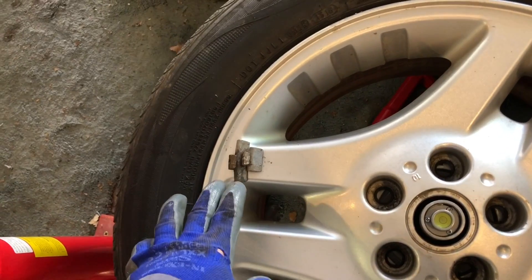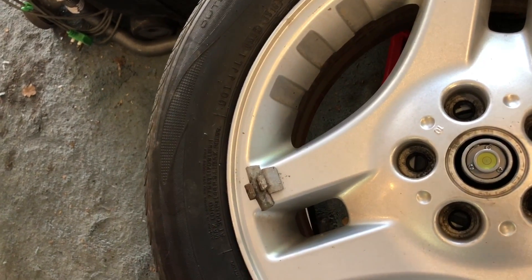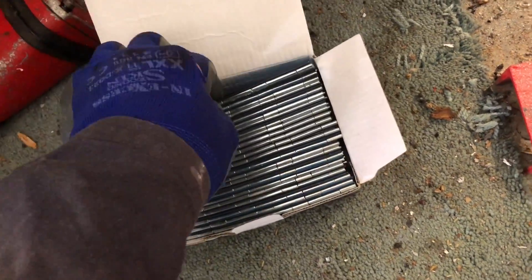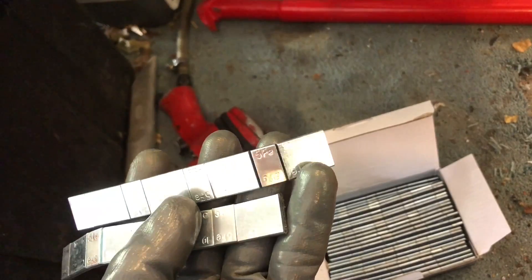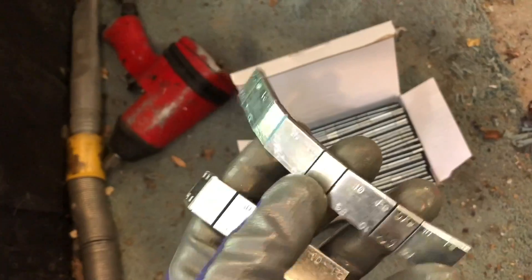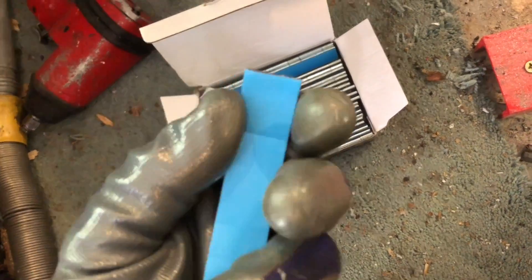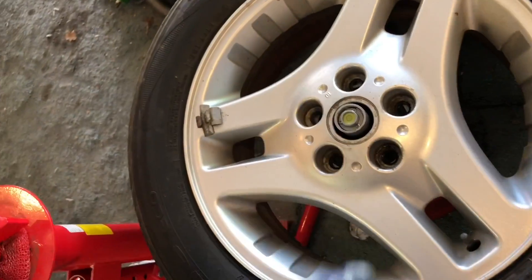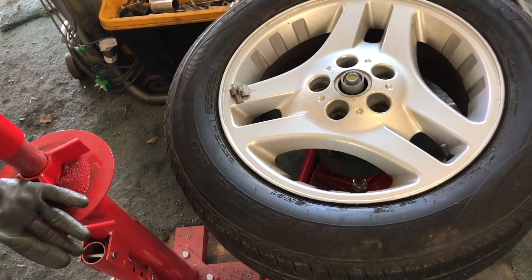Once you've found what weight will balance the wheel, use a bit of white spirit or methylated spirit to clean the inside of the tire — make sure it's grease and mud free — and then stick on your weights. Here's a box of stick-on weights from eBay for about 10 to 12 pounds — a full box, two layers. Each one is about 60 grams, made out of iron, and of course you can build them up in layers for more weight. Just cut off what weight you want, strip off the backing layer, stick it in place, and then check your tire balance again. Rotate the wheel a few times, maybe take the wheel on and off the machine just to see how consistent the measurement is. That's how to balance the wheel yourself. Thanks for watching, bye.